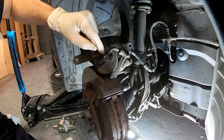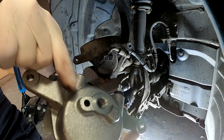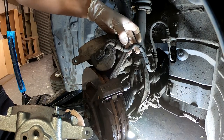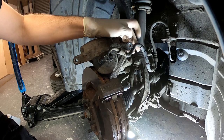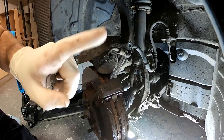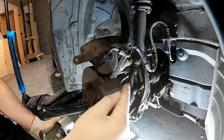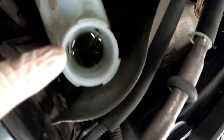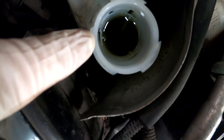There will be two copper washers — one in front and one at the metal. You need to transfer them to the new caliper. You can see the hole here and the leg that needs to go into the hole so you know it's right. Do not twist this cable — it has brake fluid in it; if you kink it you may have no flow. Keep an eye on the brake reservoir so it stays full — any air you let in will make the bleeding process three times longer.